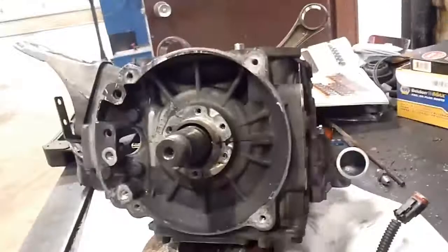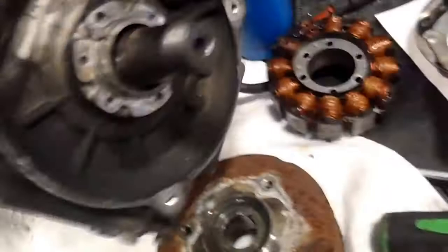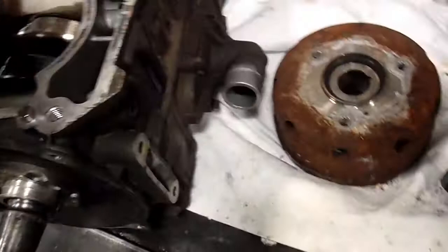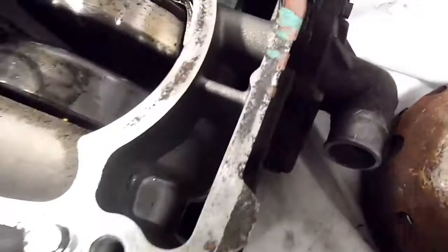I might just leave the water pump on for a moment if I can get everything apart. Next I'm going to have to take this bedplate out. These top mounts are on the top of the block, so it looks like I can start splitting the case now. I don't want to start taking too much stuff off because I'm going to have to take this home - I'm at my workshop now. There's some antifreeze in there. The coolant passages down here sometimes have some flash in them - these ones don't look too bad, those holes going to the water pump housing. That's something you want to check while you have it apart.